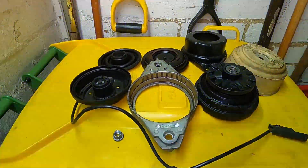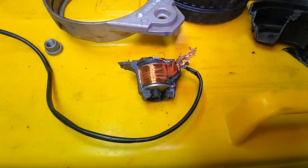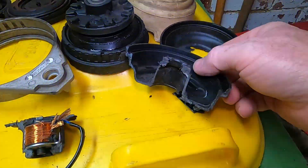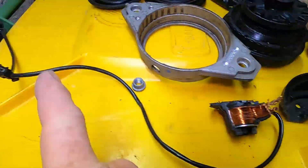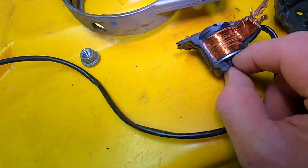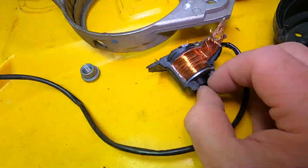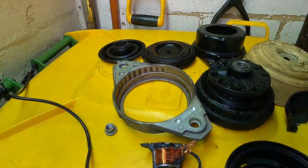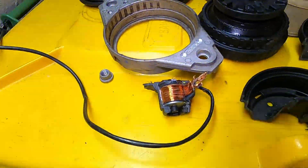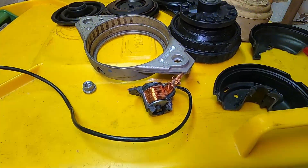A little bonus at the end of the video: this is what's inside that center piece. You've got your two connector wires or power wires coming in and then just this little coil driving this little solenoid. When that coil is fired up it can push pretty hard and block off that little air seal, changing the properties of the engine mount. Thanks for watching - don't forget to subscribe and give it a like if you like the content.